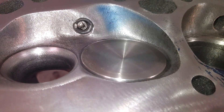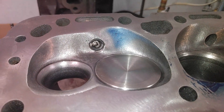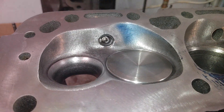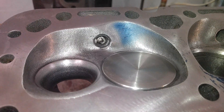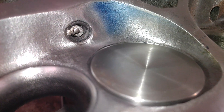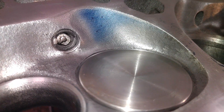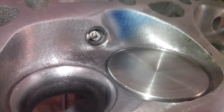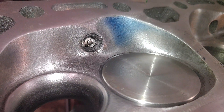Okay guys, this is going to be a short one, but I wanted to not skip it. So this morning I took a valve and put a nice straight 45 cut on it. I do think it's interesting that that blue is much wider without the back cut. Now that was at 500 thousandths.